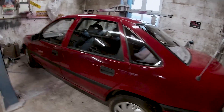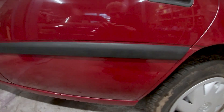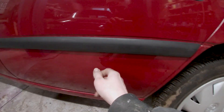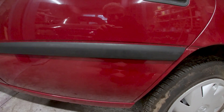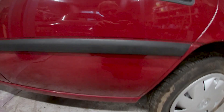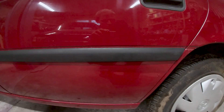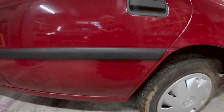So the first thing we're going to do is grind these with a wee bit of a die grinder, just take it all back to bare metal. Get the dent puller, pull this out, damp any heights down, or dolly any heights down, and get a nice skim of filler put in. I'll put the stud puller we're going to use down in the description, so if any of you guys actually want one you can go ahead and buy one. Anyway guys, metal for talking, let's crack on.